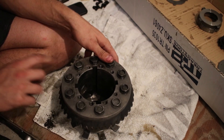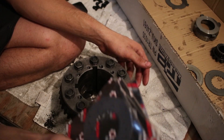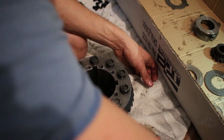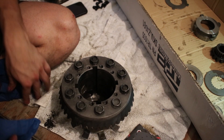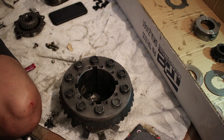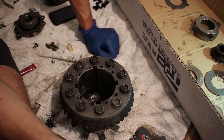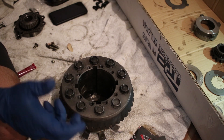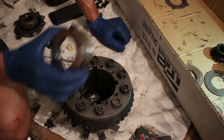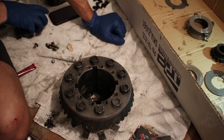All right, now we're ready for reassembly. Everything is laid out flat in order that we removed it. I've got the new clutch packs and we're just going to reverse order — put in a new clutch where it needs a new clutch and a new dog ear where it needs a new dog ear. Mike measured the existing dog ears and clutches and they really didn't have much wear, but we're still going to do the upgrade of the three clutch pack, which brings the locking percentage from the factory 25% up to around 40% lock.